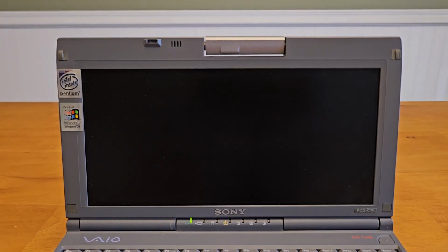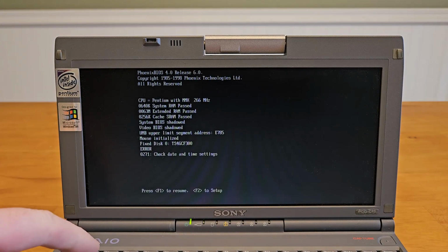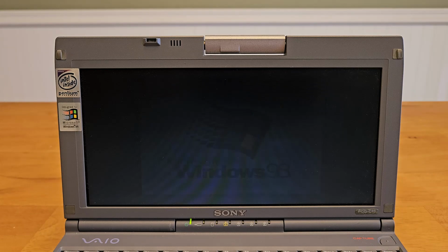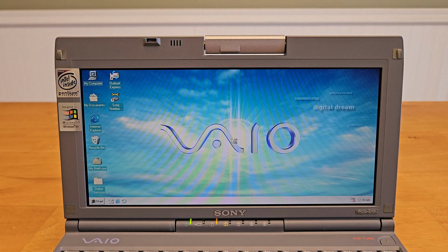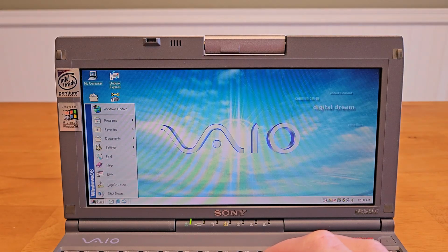I tried the reverse, taking the pack file from the US version, replacing the file in the Japanese version. But again, it didn't seem to like the file, so maybe a mismatch. So in the end, I just did a clean install of standard Windows 98, then used the application recovery CD from the US version. And although the installation wizard blocked me from installing since it saw the model mismatch, I was able to just open up each individual folder directly and run the installers from there.